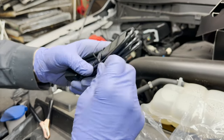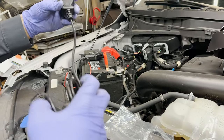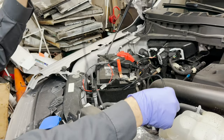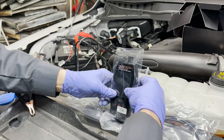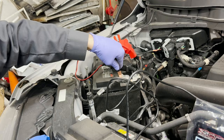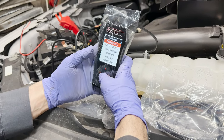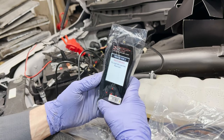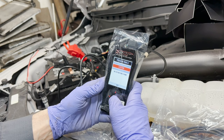The serial port is going to go into the SCT box. Kind of reminds me of old green-screen computers every time I use a serial port. Now we're going to need the OBD port plug because that goes to the actual device. The device would typically get power from the OBD port, but since we're not hooking it up to the vehicle that way, we put power on directly. The device powers up. Let's program vehicle — you can hear the box clicking, and I just heard the throttle body actuate.